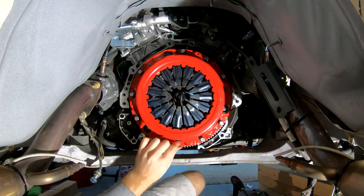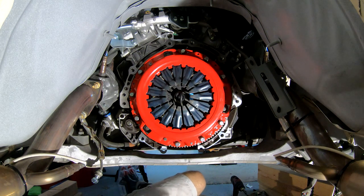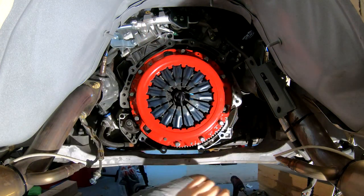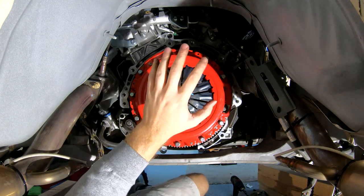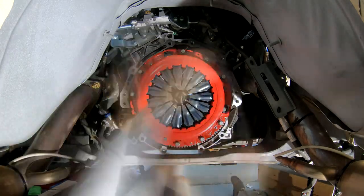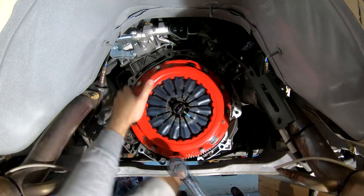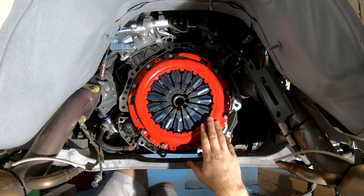I've gone and hand tightened the pressure plate and continued to tighten it a little bit with the socket wrench using light pressure to seat these bolts. Now I'm going to take my torque wrench — there are two passes we have to do. The bolt pattern going one, two, three, four, five, six, seven, eight, nine — on the first pass we tighten it down to 11 foot-pounds, and on the second pass we do 29 foot-pounds. That way we make sure that the pressure is set correctly from this plate on the clutch. With the new pressure plate torqued down to spec, we should be able to remove our alignment tool and the clutch should stay in place. That completes the installation of the new clutch and flywheel.